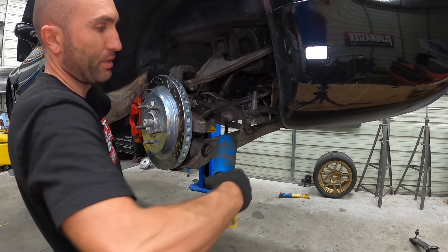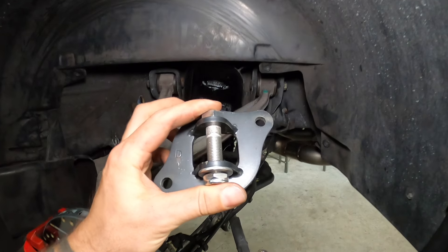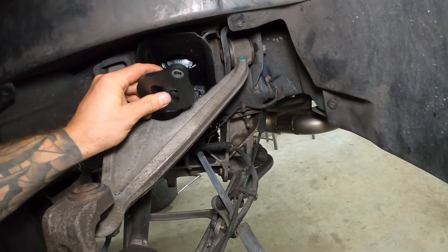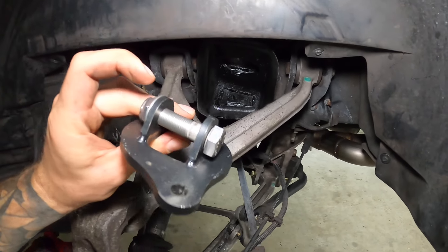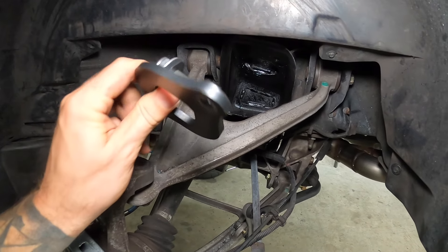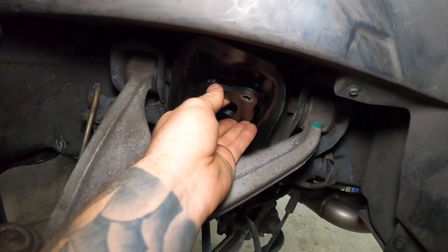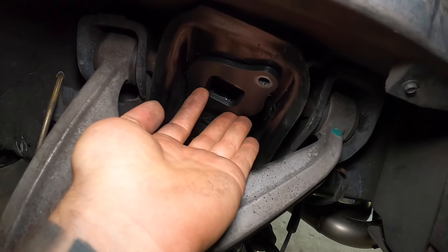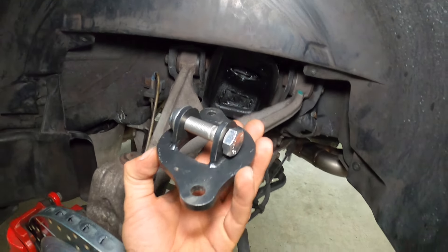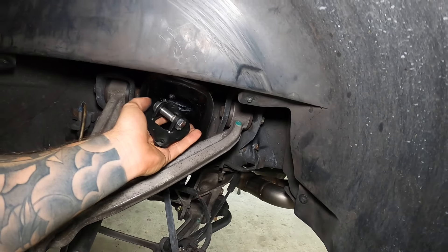The rear leaf is already removed, so now we're going to remove the bottom bolt — this is a 24mm head bolt with a 24mm nut on the back. Then there's a 13 and a 13 on top and we should be able to get this shock out. I'll show you what I did on the passenger side: I took out the outer toe link using a ball joint splitter, disconnected the electrical connection to avoid strain, and swung everything out of the way. That way I could get the shock in and out, since the coilover is going to be a little harder to maneuver. Let's get to the same point on the other side.